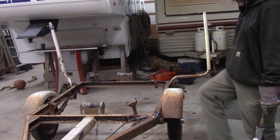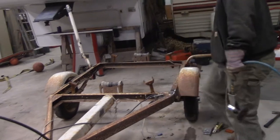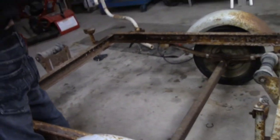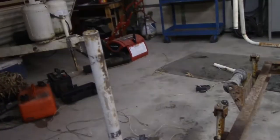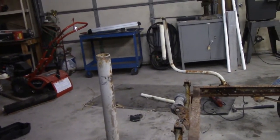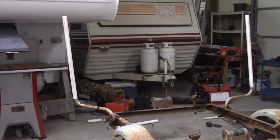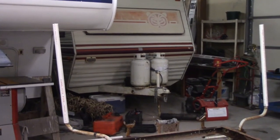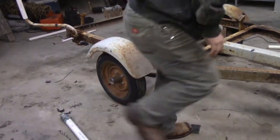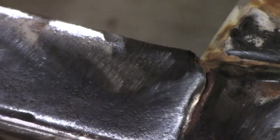The plus side is no more bouncy bouncy in the trailer — that's so much better. We have the wires stripped from the trailer and we are taking these PVC posts off because they just weren't long enough. We're gonna replace that with some new PVC posts — it's just in better shape and also gonna be longer, making it a little bit easier to get the boat back on the trailer. We got the PVC guides cut down to size — a little bit taller, a little bit easier to see when putting the boat on. We also had another crack on this side of the trailer frame; it isn't as bad, but we're gonna get that welded too.